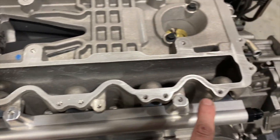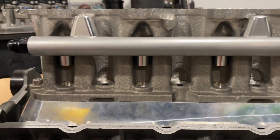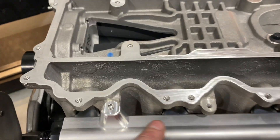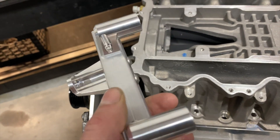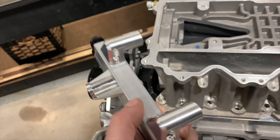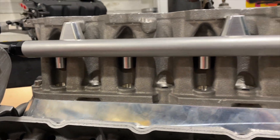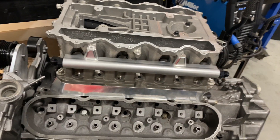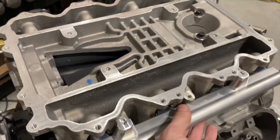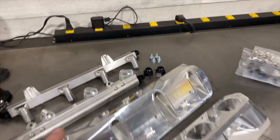They are oriented left and right, use existing bosses and the mounting hardware we supply, and get you down to a beautiful height to use truck-style injectors. If you want to run something like an LS3 — a really short injector — and keep the rail down, you can. The mounting bosses do not pass through any fluid passages, so you could unbolt these, put a spacer, and use longer hardware to accommodate ultra-short LS3 injectors if you need that extra clearance. As shipped, they are intended for truck injectors. These fuel rails are another new Fabworks product to work in conjunction with the billet adapters.